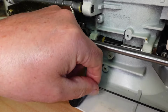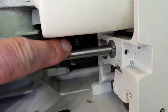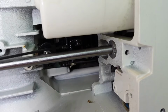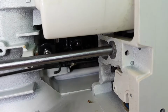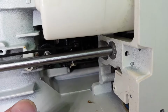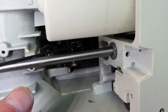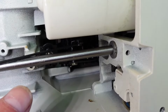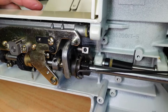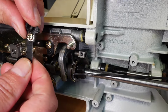And you'll see here that the little connector rod has come off, and that connects to this little linkage. A little bit hard to see because it's buried deep in the machine there, but basically you just get this hook here and you come around and hook it onto that linkage there. That's your reverse button there, lever. See that there? That's reverse. Okay, so that just needs to sit there. It's a little bit precarious. That just needs to sit there while you're putting together this part here.